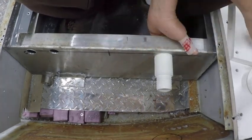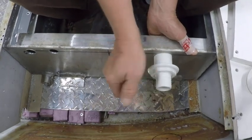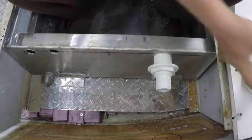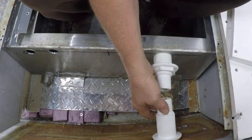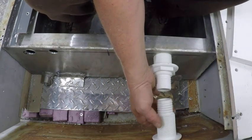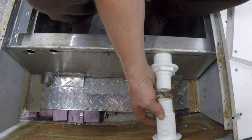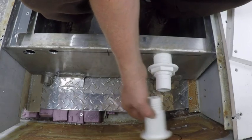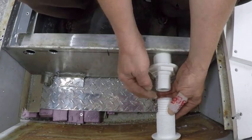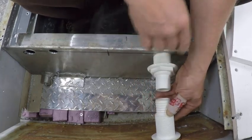Got it in. We'll put one here, just tack it in for now. Got it pushed all the way up tight. So right there is how that one's going to be oriented. Now I can go ahead and get this one figured out where it's going to go through. As you can see, they're pretty close to each other, so I've got a clamp that'll work good for that instead of having to use a hose. But right now we're just trying to mark where I'm going to drill this hole through the side of the boat. Nothing more intimidating than drilling a hole through the side of a boat, but this won't be too bad — it's above the water line. I'm making sure it's below this one, going downhill about a half an inch. So water's going to have a tendency to run out as it fills up; it won't have a tendency to lay here.